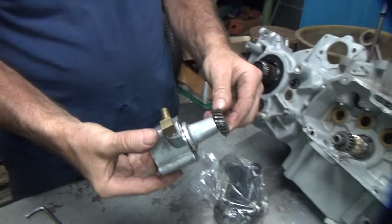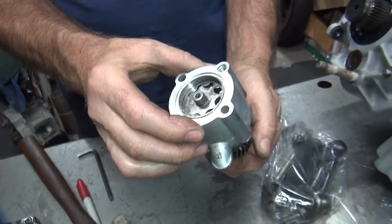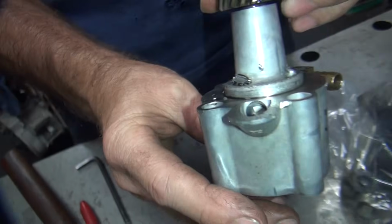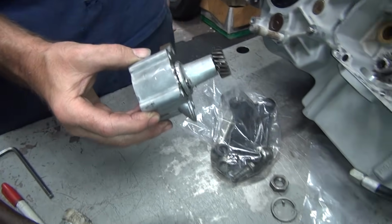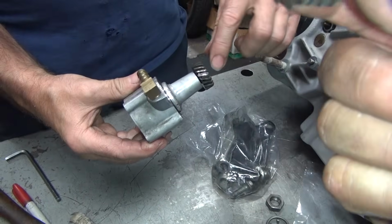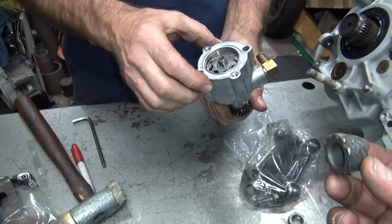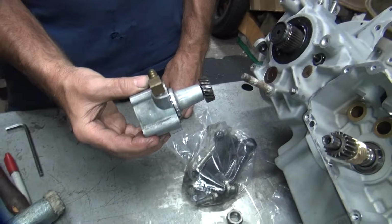It appears the oil pump has issues. Oh yeah, look at that. Oh, look at those pieces there. It doesn't seem like it wants to rotate for some reason. Well, could it be those parts that fell down that hole? Now, what broke first? The oil pump or the gear? Well, I suspect that if we pull pieces out of there, we can glue them back onto this. That probably stopped right there. Yeah. So something got into this first and locked this up. Oh, and that's what broke this. And then that's what happened when you kept driving it.